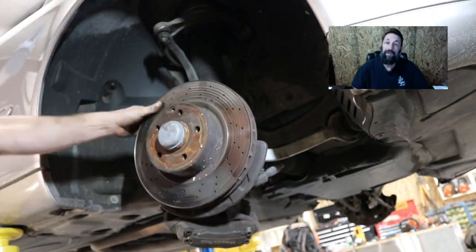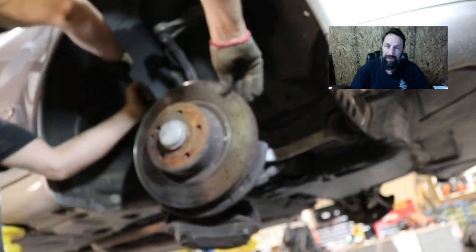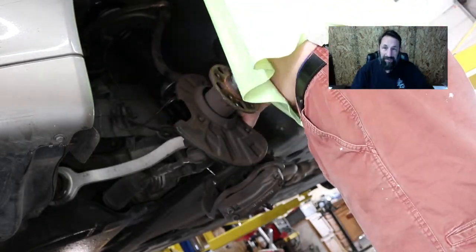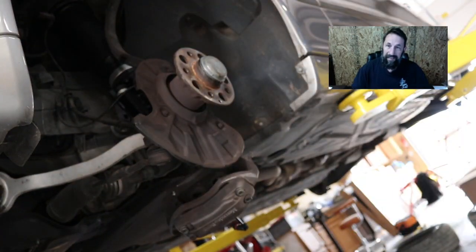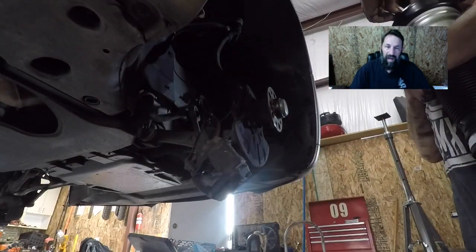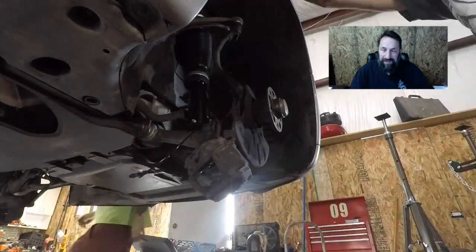The brake job went pretty typical, except Tony actually undid the caliper bolts that hold it together. It's four pistons, and it holds it together, and there's bolts on either side. He's just used to seeing bolts in a caliper, you take them off, because he's used to a single piston caliper, like from his old Dodge that he has. So we leaked a little bit of brake fluid. No big deal.